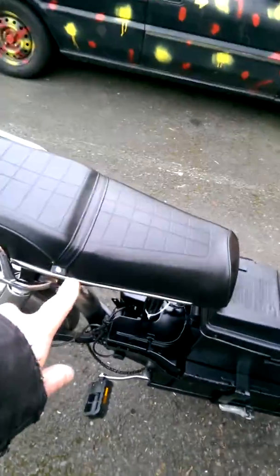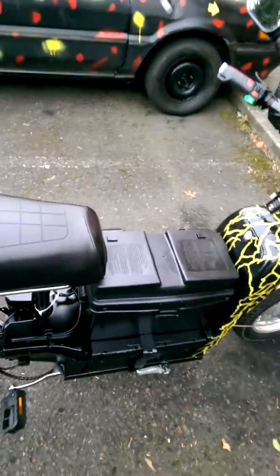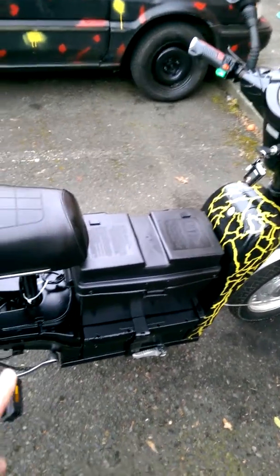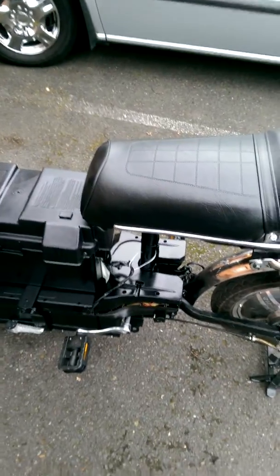It's got a motorcycle-style seat — brand spanking new. The rack in the rear is new. The frame is new. I redid the plastics and repainted them. They used to have a heavy gloss black; now it's more of a matte black. I upgraded the paint on the frame so it'll withstand the weather. I even waterproofed the connectors on the inside — all the connectors have hot glue and vinyl attached to them to keep the water out in this nasty wet weather we have in the northwest.